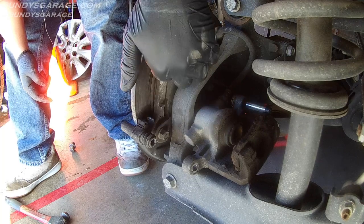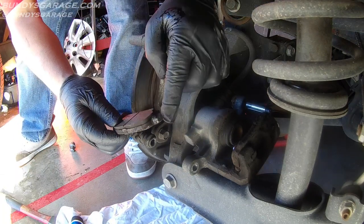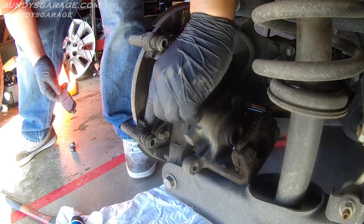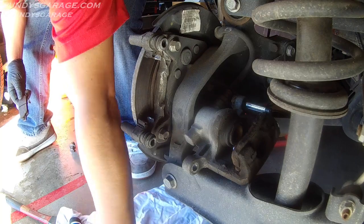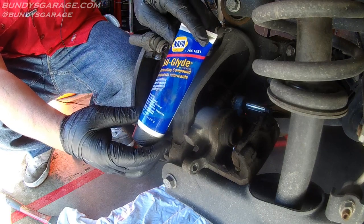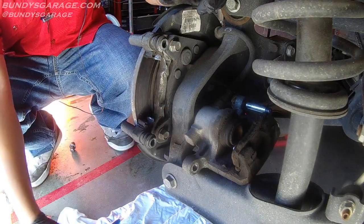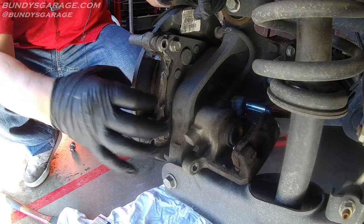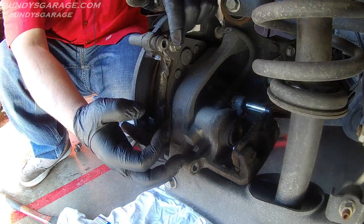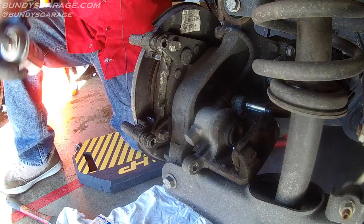These slides right here — there's one on top as well. The brake pad slides on this metal part, which can get stuck and needs to slide back and forth. You want to clean this up with some brake cleaner and a steel wool brush or toothbrush. Then we're going to apply some Siliglide from Napa — it's a synthetic, non-melting, non-freezing, non-gumming lubricant that helps the pad slide evenly.